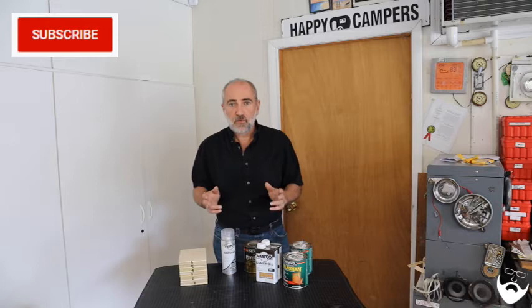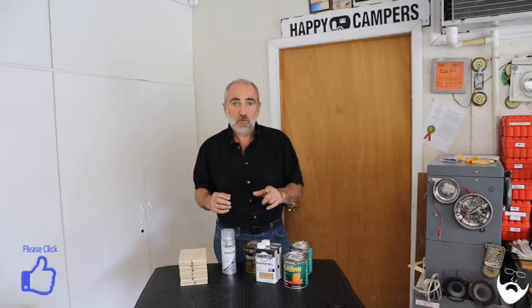In this video, I'm going to talk about the ever-changing weather climate in your van. The moisture in your van can pose a real health problem. I see in a lot of people's YouTube videos, when they're talking about something else, a lot of untreated, unfinished wood. Often in the garage area of their van, I see untreated raw 2x4s, which are commonly made from pine, a softwood that really will absorb moisture.